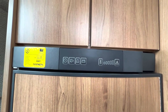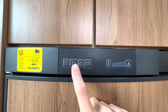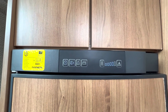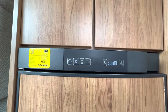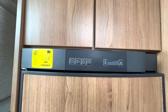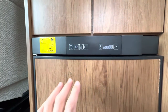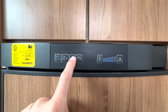To operate your Dometic fridge, you've got your on/off button here. You have three sources: mains hook-up on 230 volts, so it'll act as a household fridge if you're hooked up on a site or pre-chilling your fridge before you go away. Hook it up at home, charge the leisure battery, put your fridge on and chill it with nothing in it for a day or two, then the night before put your shopping in and allow it to chill on mains. You can also select 12-volt battery — when you're travelling with the engine running, it'll send a 12-volt feed to your fridge to keep it fresh. Or you can select gas, which you'd use if you're wild camping.